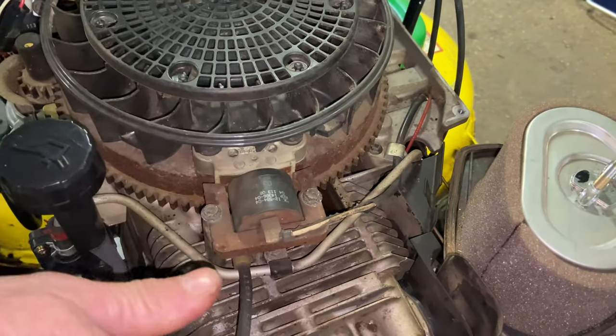It is sheared — because this is where it's supposed to be and the other piece is in here. You can see right down inside there — see where that yellow mark is? That keyway is sheared. So here it is — the sheared key. What we have to do is get both pieces out, put a new keyway in. Here on the bench are the two pieces — the two halves. It looks like a half moon when they're together. I got one piece out of the crankshaft side and one from the flywheel side.